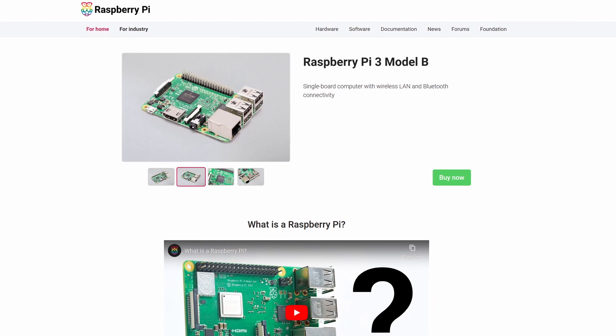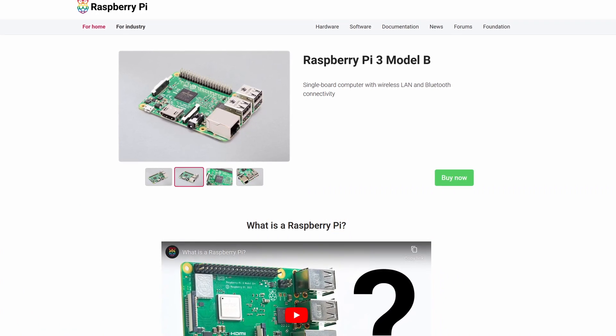I first started my journey with Home Assistant a few years back and back then I used a Raspberry Pi, the Model 3, Revision B, something like that. That didn't run well at all. Because of the low read and write speeds of the SD card, my Home Assistant instance would more often than not crash or freeze. After a few months of frustration I decided to migrate to a different type of machine.